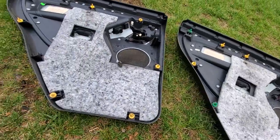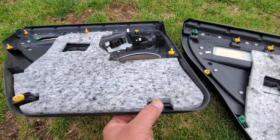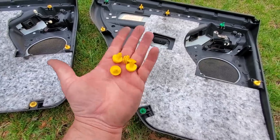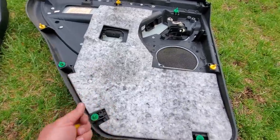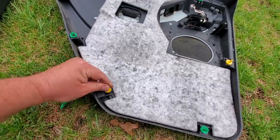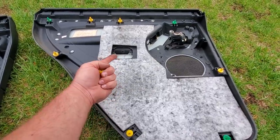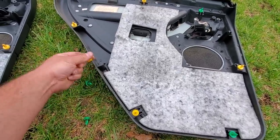When you put your door cards back on, check all the little fasteners and make sure they're not busted like these are. There's a good chance they may all be busted and you won't have a complete set — so I went online and found these on Amazon. I'll leave a link in the description. I think I got a bag of 20 for about six bucks. Go ahead and slide in a brand new clip — this is what really holds your door card on. The interior panel only has two screws; the rest is all these clips.